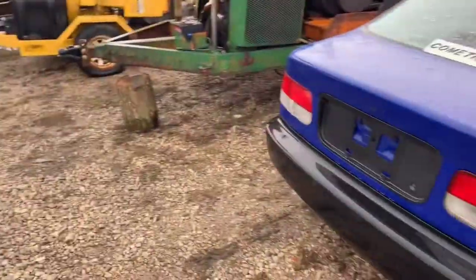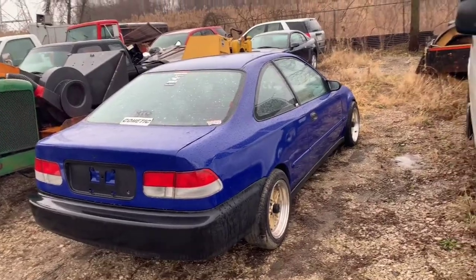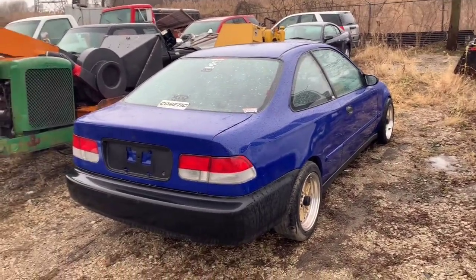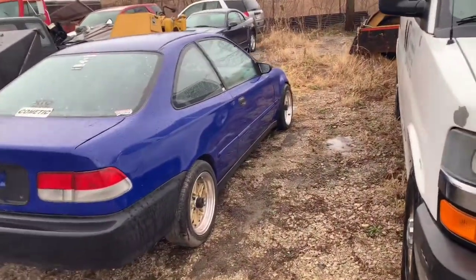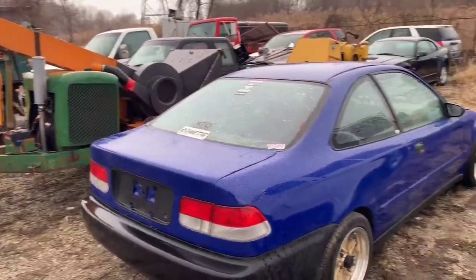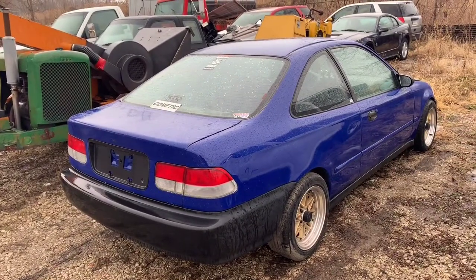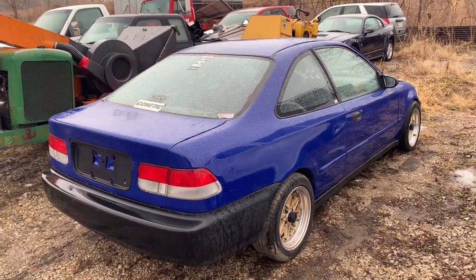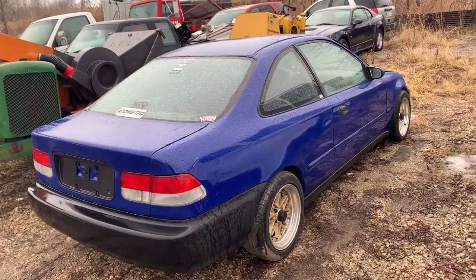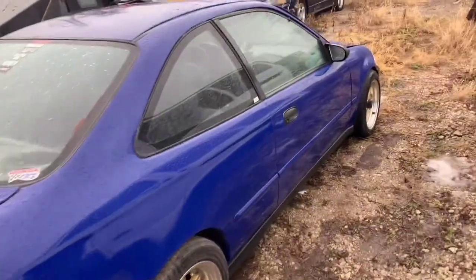You'll see it in a minute. H22 A4 or A3, and painted it up and everything, made it all look good. New blow off valve, intercooler, a lot of new parts, and my old engine, got that up on a stand, gonna pull that apart and put forged pistons and H-beam rods in it and stuff. Eventually get it sleeved so we can be making some real horsepower.